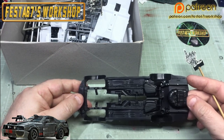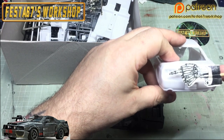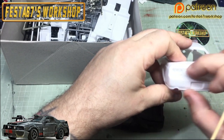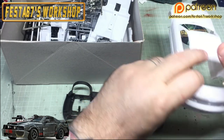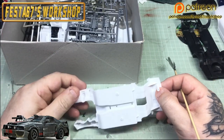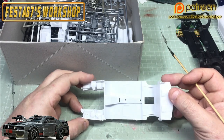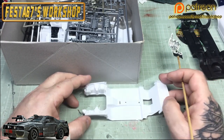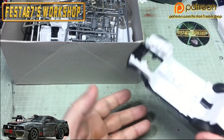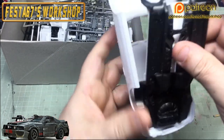All of this body shell is going to sit on my bench for a few days. The floor pan — again we're going to have big sheets of armour under here protecting everything from underneath explosions. There's a baby fuel tank there, but I'm going to fab a fuel tank, because on the car in the film there's what's known as the tombstone on the back. When that's dropped, there's a huge fuel tank sat in there — so all of that's going to get cut out and the fuel tank's going in. I'm going to be doing a removable tombstone.